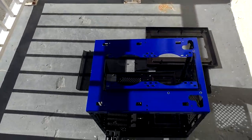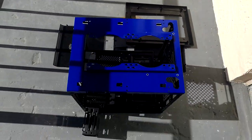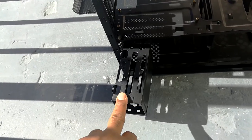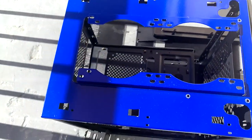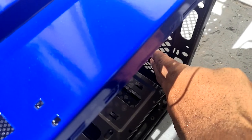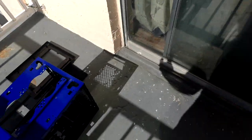Here is the case. Damn good case. I like it because it has that vertical mount motherboard tray. Just like I said, y'all saw the dirty pictures. It was filthy. I brought this baby back to life. Here is the 2.5 hard drive bay. There's your two 3.5s. Your vertical mount motherboard tray. Your cooling fan up top. You can hold a 240 radiator up top. Up front, you can put a 200 millimeter, 140 millimeter, or a 120 millimeter, and you've got a 120 millimeter in the back of the case. Like I said, it's a nice big case. That's why I call her Big Susie.